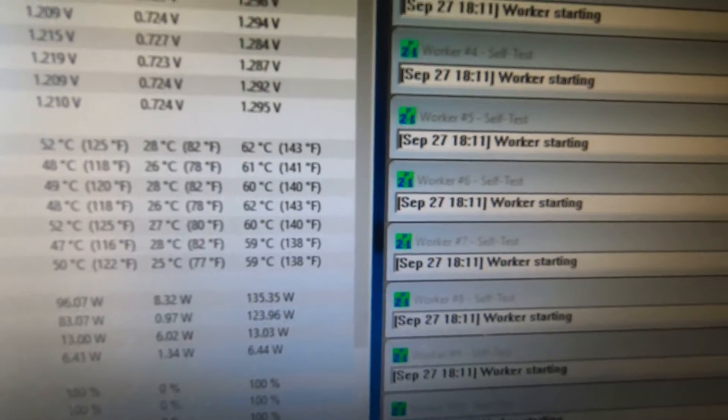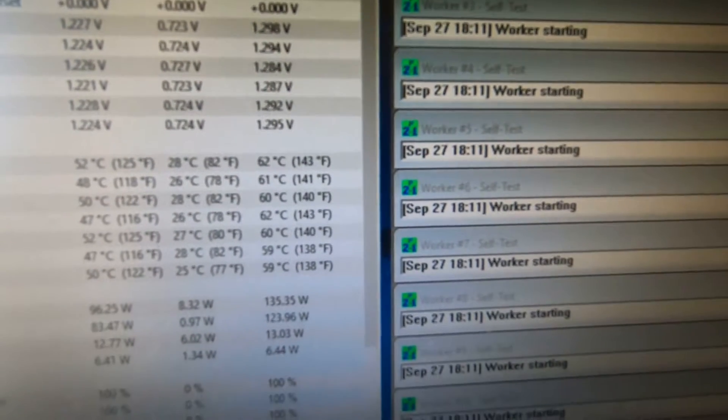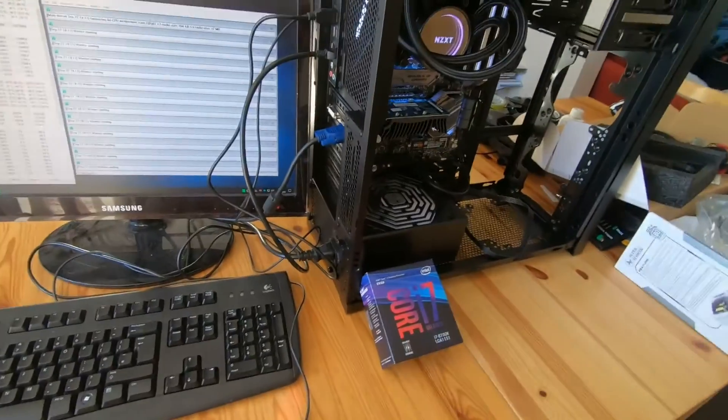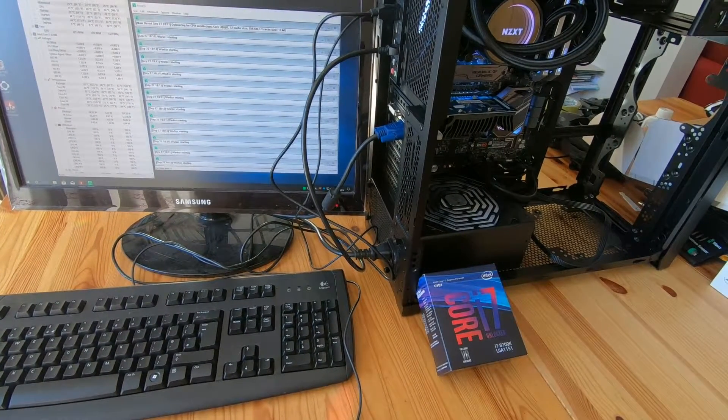Does Intel use toothpaste? Is that what they put on there? Because that's like 30 degrees less than you typically get with an i7-8700K, which notoriously runs hot anyway. I'm going to be delidding every single CPU I get from now on because that's a massive difference in temperatures. This has been running for three hours on a warm day in an open case. The graphics card isn't exactly the world's most powerful — it's a passively cooled GT 210, just in there for testing.